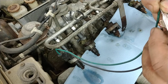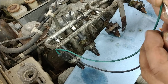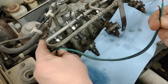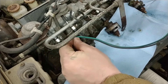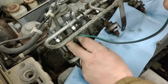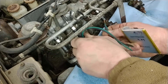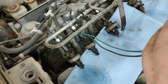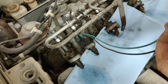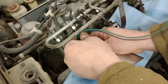It's not leaking, and when I energize the injector it sprays — actually spraying pretty decent, not too bad. Moving on to the next one. I took the clip off so it'll make it easier to plug in. Alright, now that we've got some raw fuel on the engine, let's see if we can create a spark.